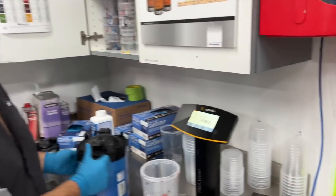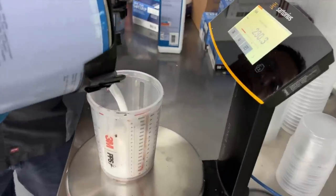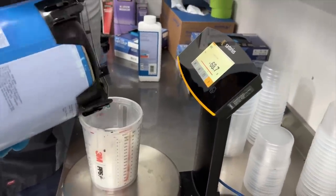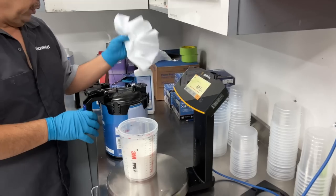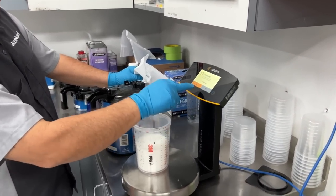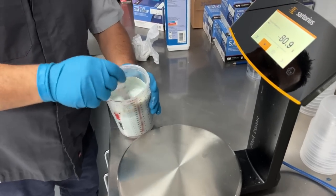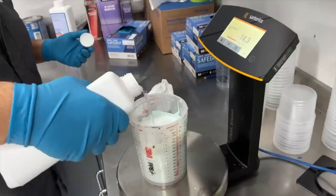We want the light to go through the layer and reflect the ground coat — that's the goal of the mid coat. Juan decides he needs a little bit more than what he originally entered into the computer, and that's no problem for the digital scale — he can go over and recalculate the remaining ingredients to match. After mixing in a few more ingredients, Juan mixes everything up for the mid coat and then adds the activator. Now Juan has everything he needs to finish the paint job.